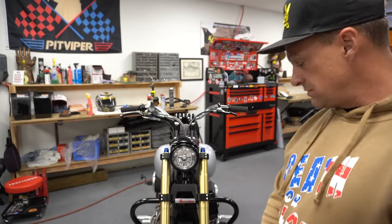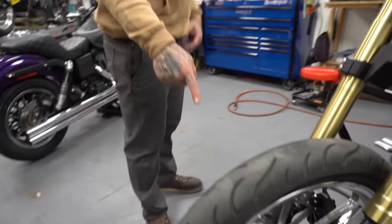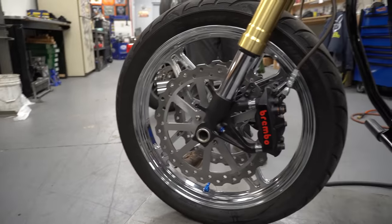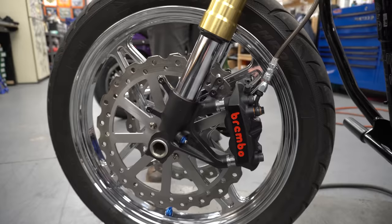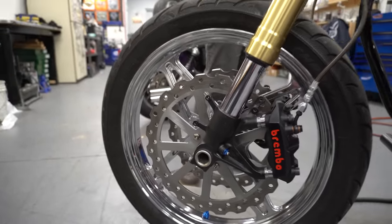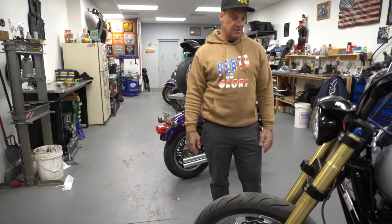Down to the wheels. It's a little bit of a mock-up on the wheels. It's not totally done yet because we're gonna have matching rotors, 13 inch Northstar R brake rotors to match our wheels that are on here, the Northstars. I have those matching rotors on my bagger. I put them on that one so it looked better, and I had these for mock-up. I'm still waiting on another set from Jay to get cut. But they're 13s, it's our Northstar 19 inch rim. Brembo radial mount calipers, hooked to those fancy brake lines.